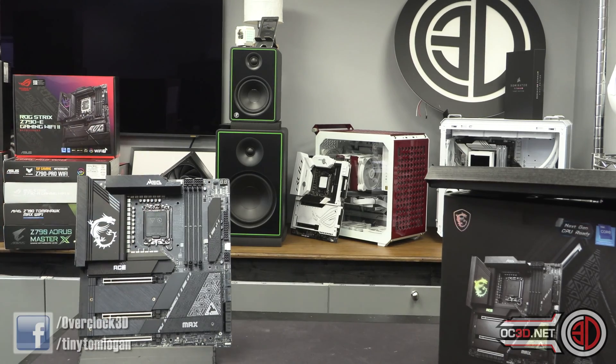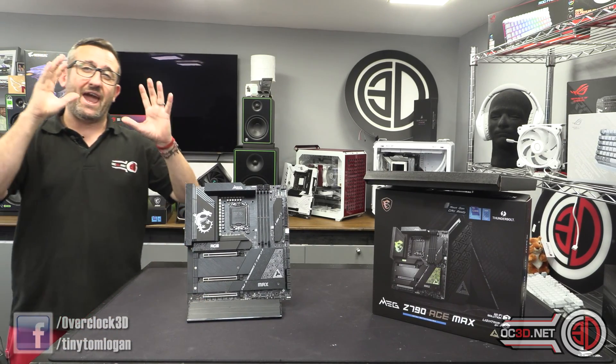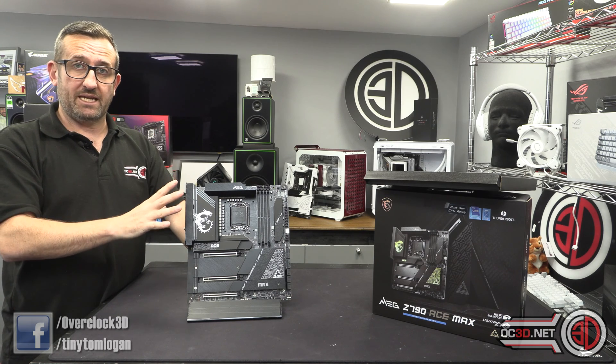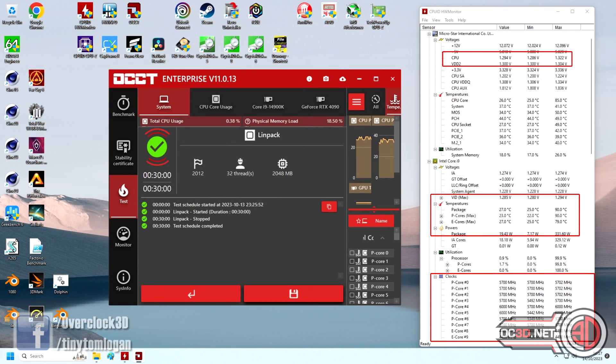MSI have thrown a lot at this board. Now, talking about performance — one thing I will say, and this goes for every single one of the boards tested: I have been undervolting the 14900K from the stock voltages. The Intel reference voltage puts the 14900K at about 1.4 volts; my chip specifically I've been able to get benchmark-stable at 1.3 volts. I'm going to be doing undervolting guides for Gigabyte, MSI and Asus so the BIOSes are all familiar. I haven't had time for launch, but when I build the Tomahawk for review, there will be an MSI undervolting video.